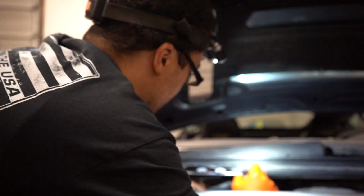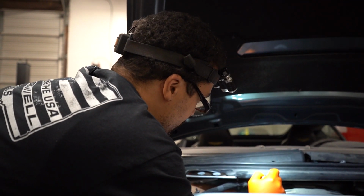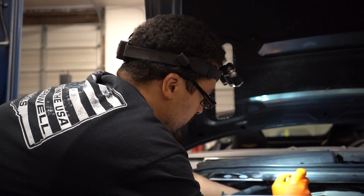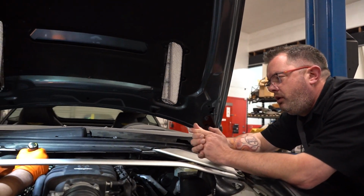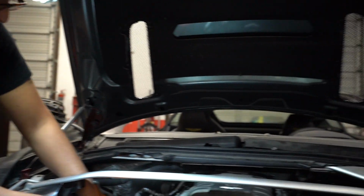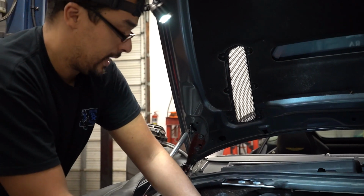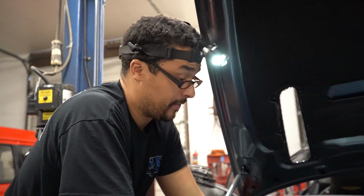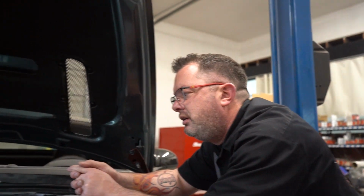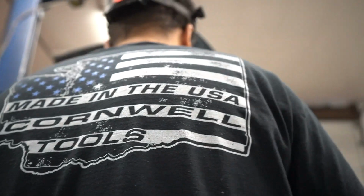We moved the starter wire to the spot on the body, and now we want to crank the car without a jump box to see if it will crank without a jump box, which would indicate that it's getting all the juice it needs. Before we crank it, should we put the new ignition switch in it? No. So where did the wire go that you had it attached to? We don't know. But it's fused power, so that saved our butts. Every time it blew the fuse, that was what saved our butts. Oh, is that why we were blowing the fuses when we were cranking it? That's very likely why we were blowing the fuse, so it was actually saving our butts, which was kind of nice. I've got to give kudos to Aston for that one.